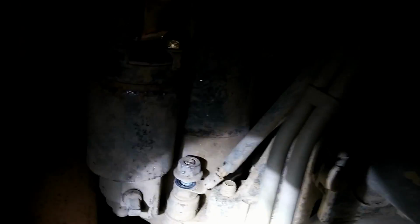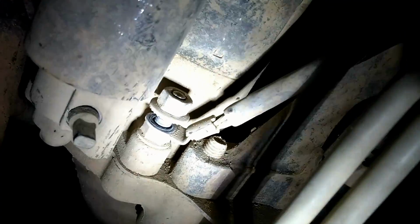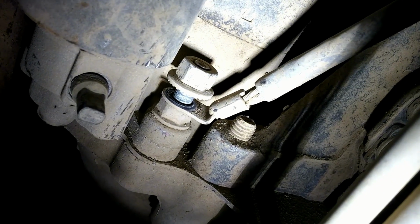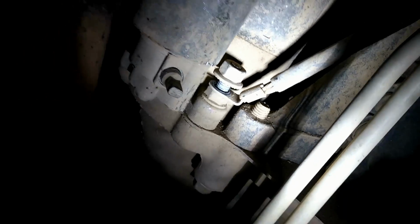So we're underneath the van here, and you can see on the top right there, that's the top bolt. I already took out the second one, and there's the bottom one. So remove those 3 bolts holding it in. This one has a nut. You first remove that nut that's on top there, and then you remove the secondary nut or the bolt that's actually holding the starter on.